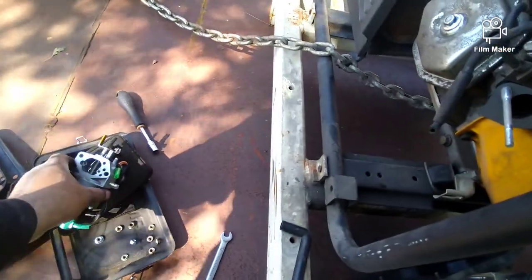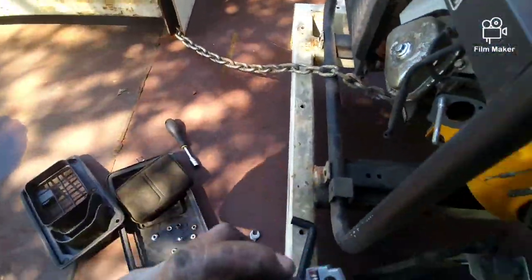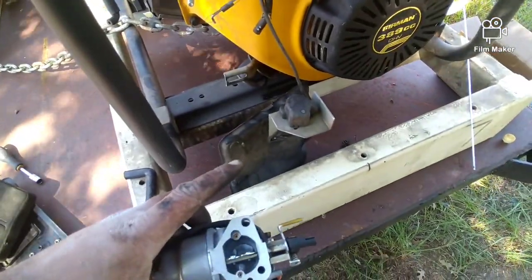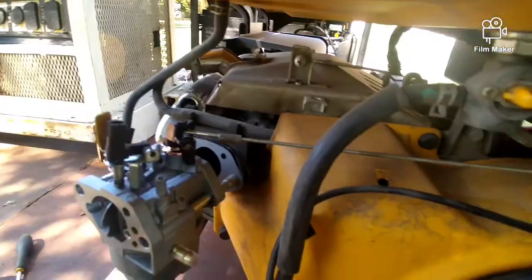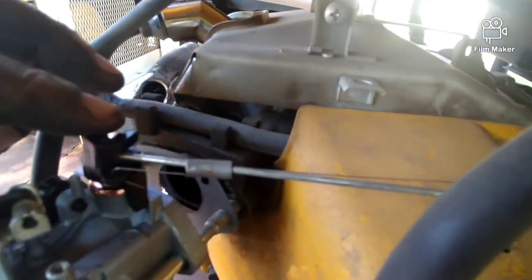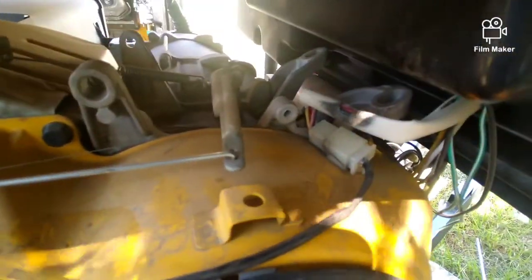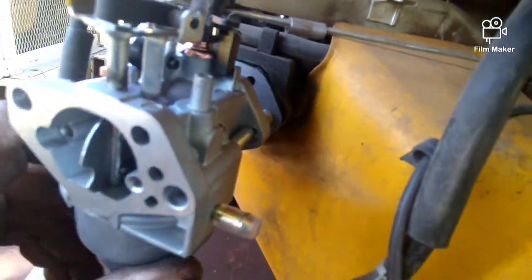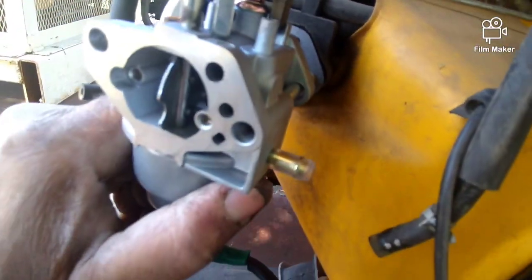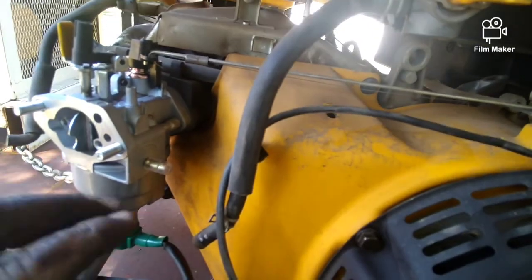And when you put it in, then you have the other gasket here, and then that cover goes on. So just make sure there's not an old gasket stuck to it. All right, so I put on the governor pieces right there, the spring and the little piece to this arm. Sliding it on now. Always want, okay. Slide on.